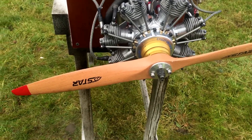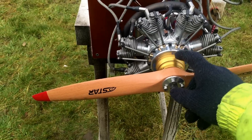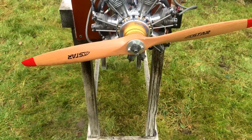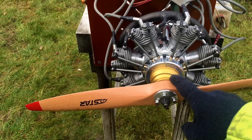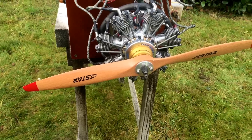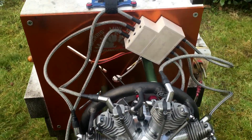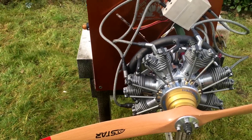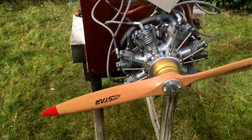There will be some links in the description of this video where you'll find links to the parts: the magnet ring, sensor bracket, ignition, and a WT carburetor conversion as well. I do have another engine of my own where I will test with the WT carburetor and see what the difference is with this FG 84 carb, and see if there's any big performance difference. The ignition you can see is a one-unit RCXL brand. I do carry the CH ignition brand as well, so it's your choice. I'm going to give it a fire-up and see how it goes.